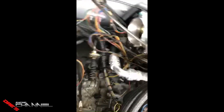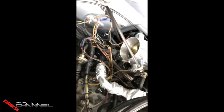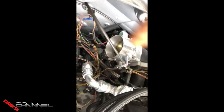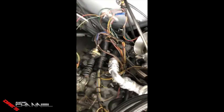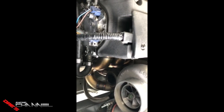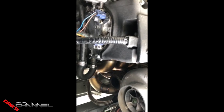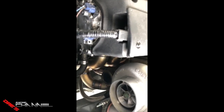The camera was right there recording me working on it but it died and I can't find my second battery. I'm going to pull the throttle body out, then wrap these wires and tuck the spark plug wires underneath. I also took the wastegates off because I couldn't get the clamps to seat right, so I ordered some new clamps — hopefully those will work.